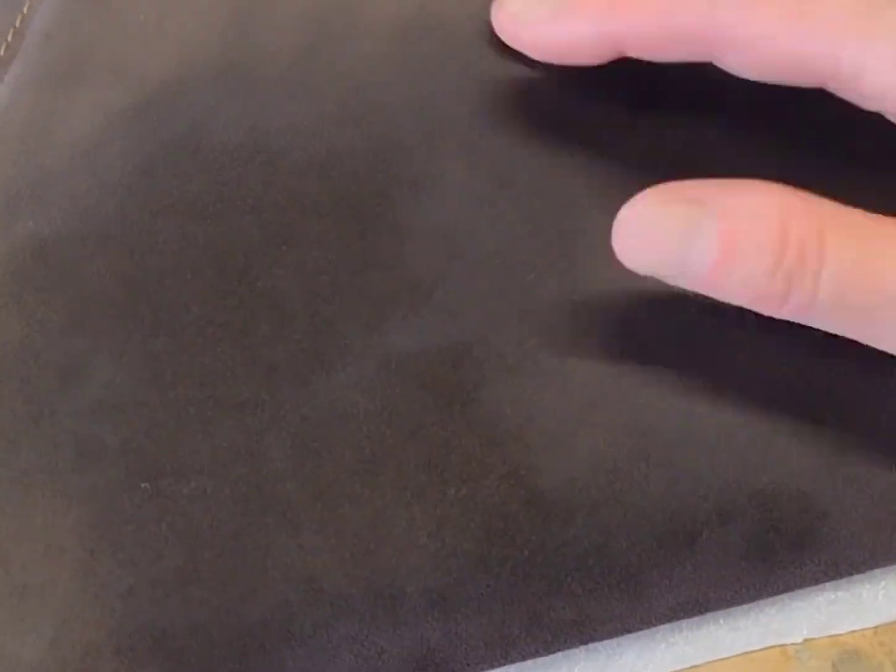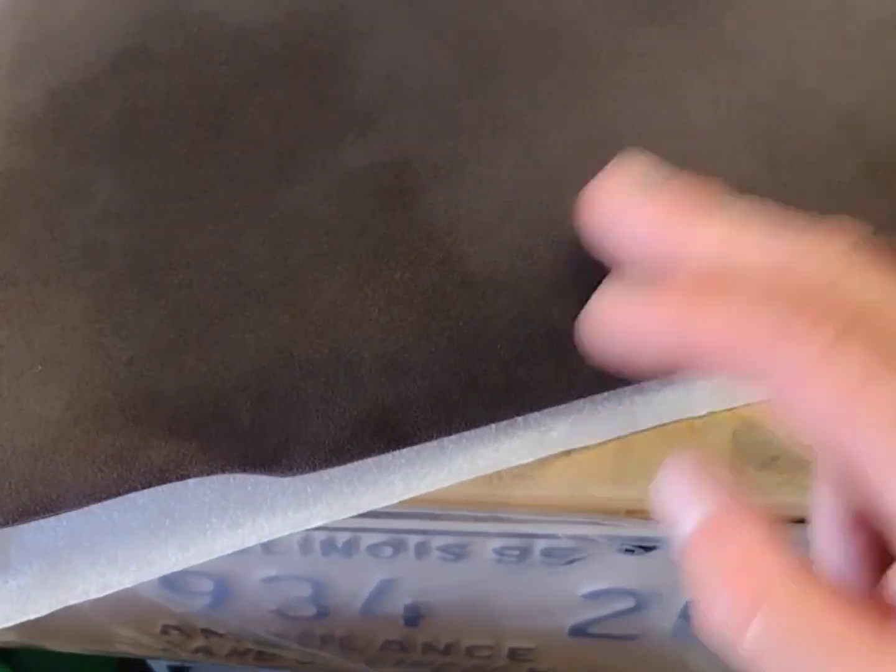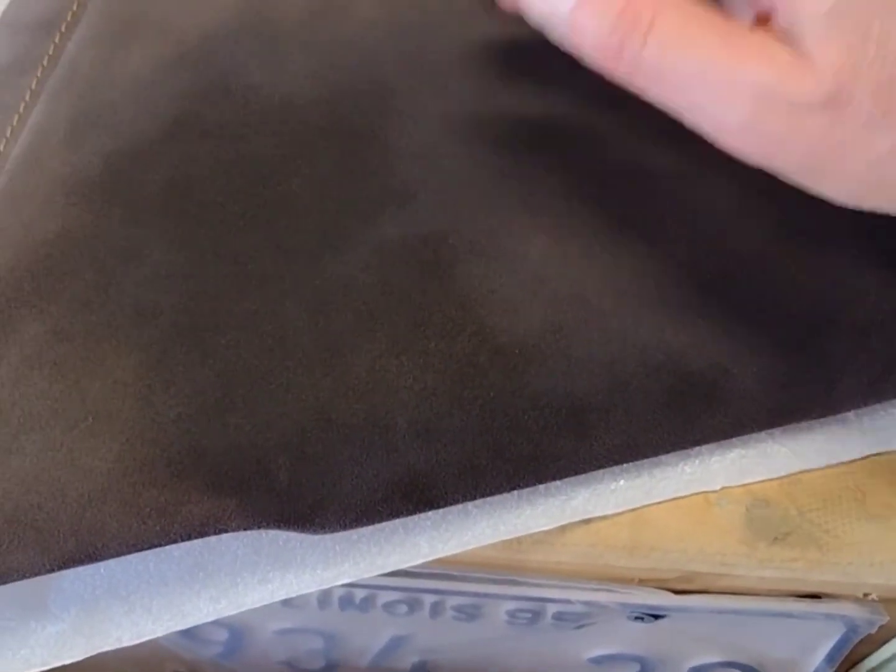Like if you ever painted, they call it blending, where you blend in the surface from where you painted to where you didn't so that it matches. We're going to find that out together, but as you can see, I'm trying to blend this out here so that I don't see that line. We're going to let this dry again, and we're going to show you.